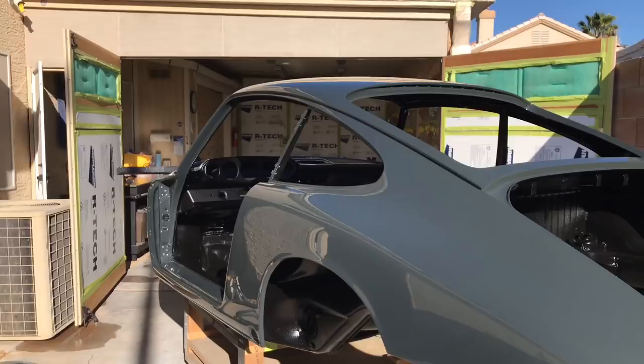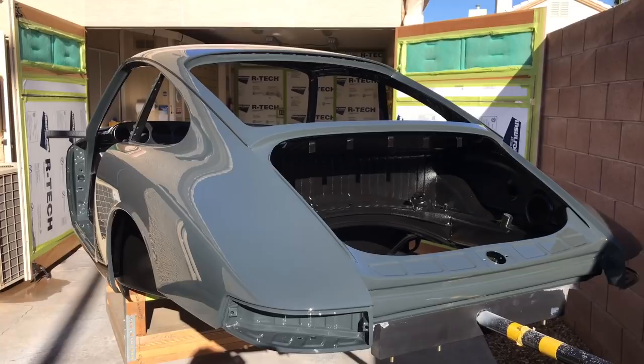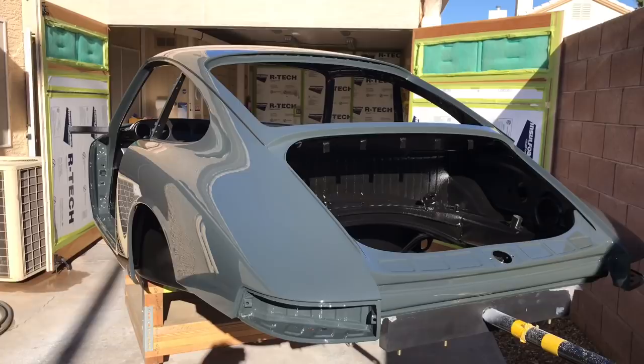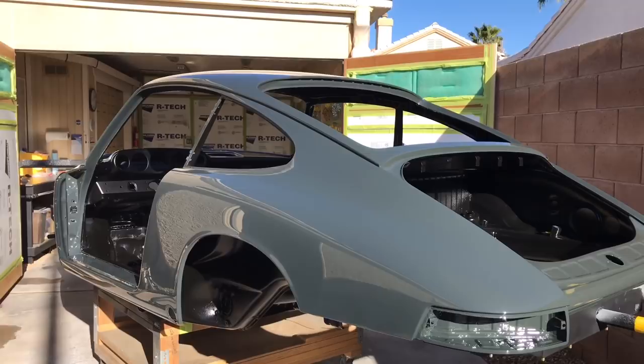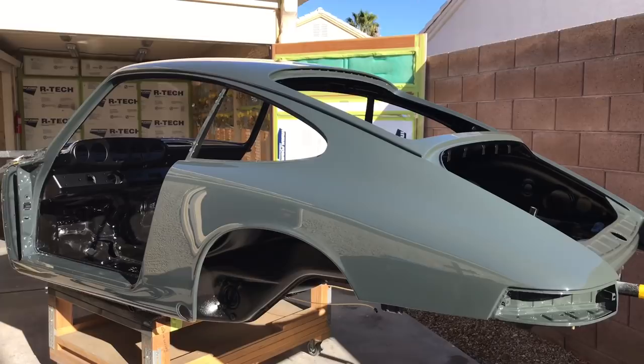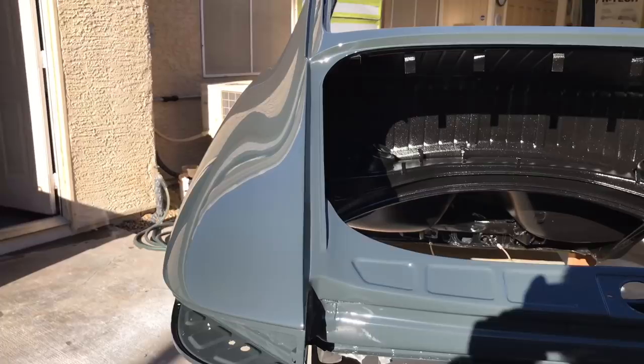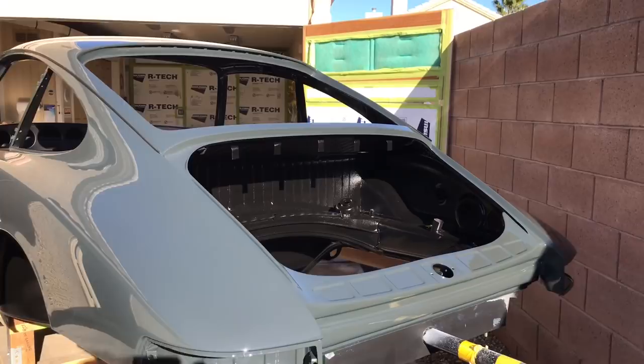For me, I'm used to working in these conditions and I'm comfortable with it. It's also in a spray booth area with no traffic — people aren't walking through it, no family accidentally brushing up against it. It is a dust-controlled environment so we can keep the dirt and dust out. But Michael's biggest concern is a potential accident during assembly, so I've got to be very, very careful now. The reason I did this now is to take advantage of the rotisserie and also the messy conditions — I like to use a lot of water when compounding, which is messy, and you'd get sling all inside the engine compartment. I can also get into areas and tight spots that I just can't access when the car is in finished assembly. It's not necessarily for everybody under all conditions, so definitely give it some thought before you take this on.